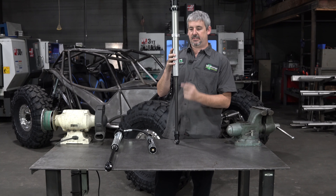On a remote reservoir, as you push the shaft into the body, the floating piston moves down and just puts nitrogen pressure into the reservoir — it doesn't really become an issue, you can't really feel it. If we're doing anything over a slow crawl or slow trail riding, we're going to push for that remote reservoir. But for rock crawling, plain old trail riding, and slow speed stuff, that emulsion shock will do you just fine.